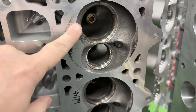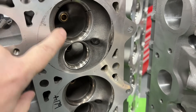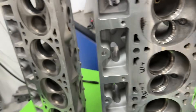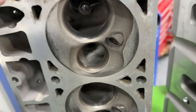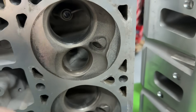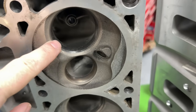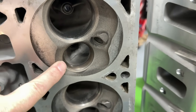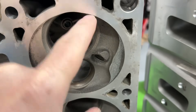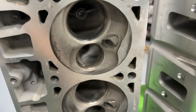The Enforcers have a 2.08 intake valve and a 1.600 exhaust valve. Their chambers are relatively large — I want to say in the 70cc range. And then these are just the 823s. Again, these were run but I've blasted them since because I'm going to do port work on them and re-dyno after porting. These are 823s with a 2.165 intake valve and a 1.590 exhaust valve. All I did was valve job and blend — just a refresh job, very generic.